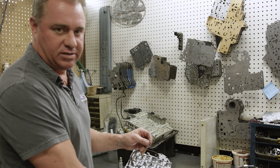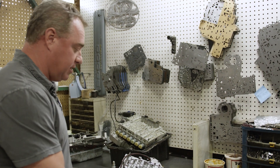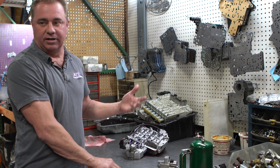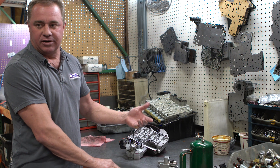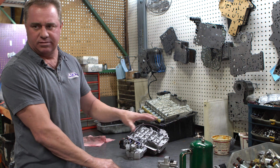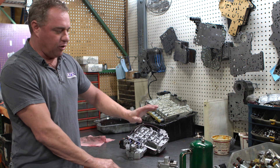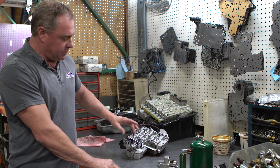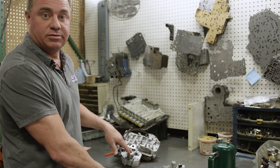Like I said, it's Chrysler's number one part they sell. Generally these things within 40–50,000 miles they're failing, causing your transmission to go into limp mode, stuck in second gear, not wanting to upshift, not wanting to downshift — all kinds of shifting scenarios generally related directly to the governor pressure solenoid. And many times it will also set a check engine light.